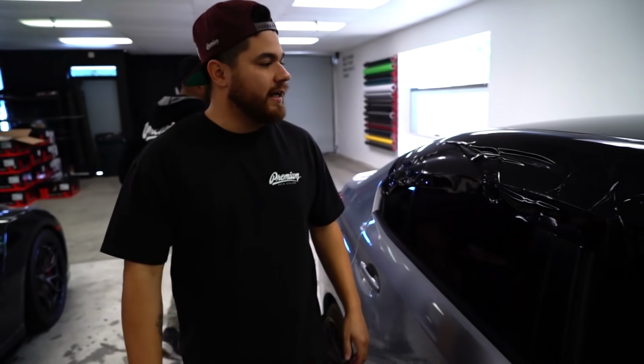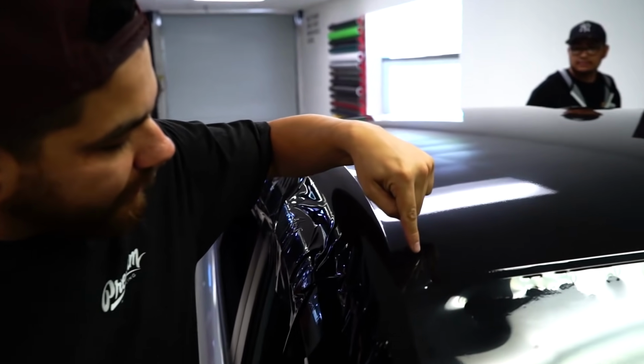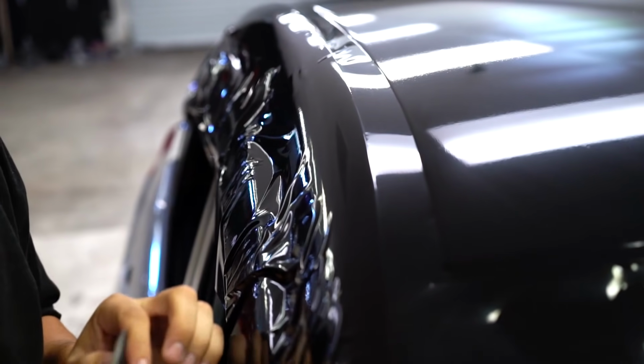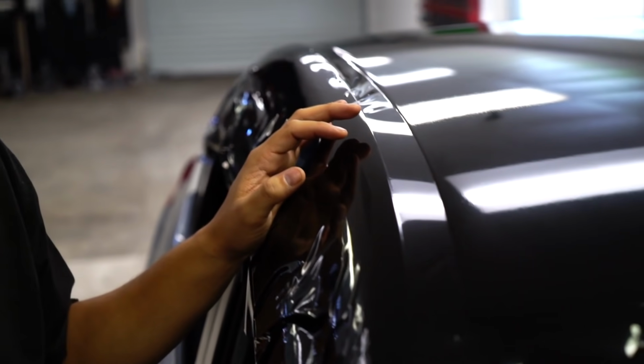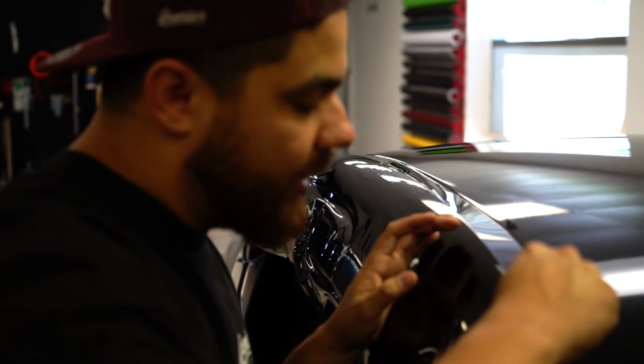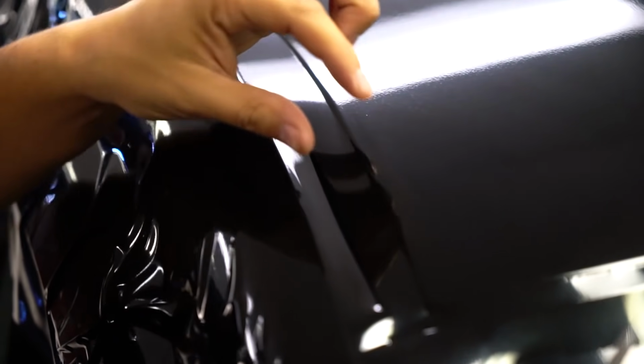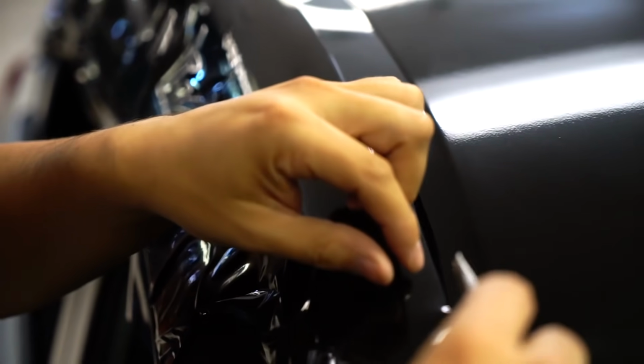Now that the roof has been laid, you're gonna have to start trimming. So what we're gonna do is we're gonna use the open space right in between here, and we're actually gonna use that to cut. At this point, you're not cutting on anything. You're just using an open air space. So I'll show you right now, using the center point. This is where that roof rail used to be. So I'm cutting it giving it about a 1/2 inch extra to go down into the channel.